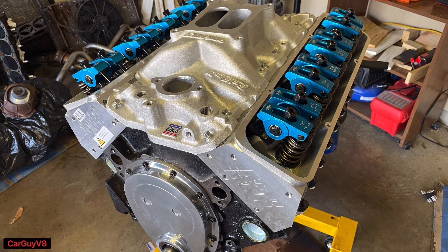The XR282 is a hydraulic roller. I wound up running factory lifters because when I bought the cam I didn't know I'd have a roller engine, but I put it in a factory roller block with factory roller lifters. It has the AFR Enforcer cylinder heads and PRW roller rockers. The actual top end of this engine wound up being about $2,800 — yes, that's some change — but it makes a little over 400 horsepower.